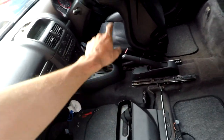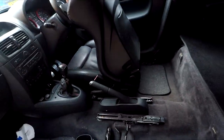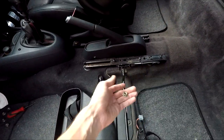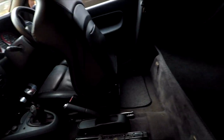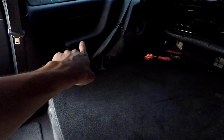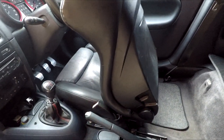I've whipped the passenger seat out. I tried to see if I could manage with just the one seat out, but there's no chance — I do need to get the driver's seat out as well. It's just 13mm nuts, five on each — you take them out and pop the seat out, leaving the rails in. Before I take too much of the back out I wanted to see if the cage would fit with the plastics in. That's why I think people get rid of them and change to track door cards.